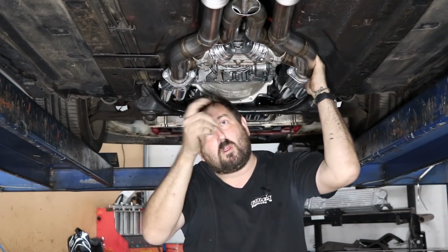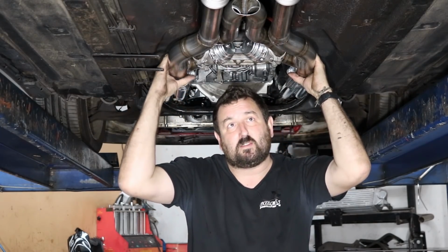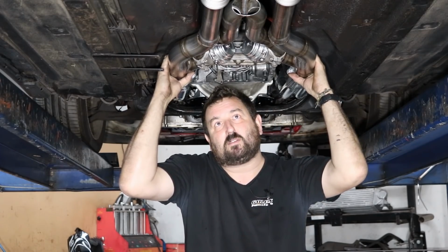We've got the turbo bracket made. It actually turned out exactly how I anticipated it would. Ended up using a sandwich plate for the exhaust feed because originally I was going to weld pipes straight to the actual bracket itself, and it would have been too cumbersome to move it in and out. The stuff for that, my parts haven't really shown up.